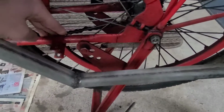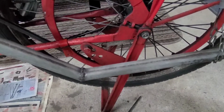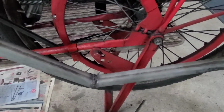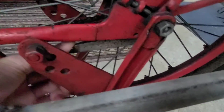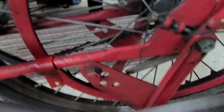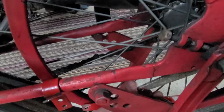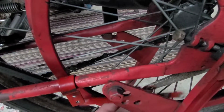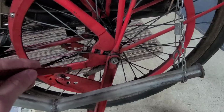Today we're working on improving the brakes. Last week when I went for a drive, everything worked fine, but as soon as I got home and I used the brakes just before I could actually pull into the garage, this assembly rotated, and the way it was mounted was this rod went between the two. So when that turned, this pulled forwards, which pulled this forwards. And the end result was it started to try and wrap around the actual wheel in there, the drum.